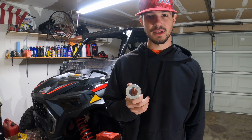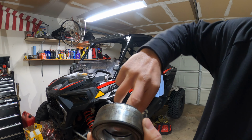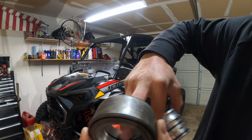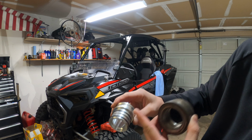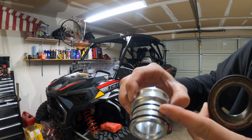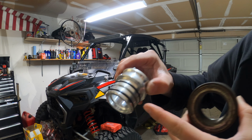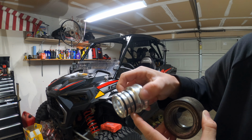And if you're wondering how this greaser works, I have an old bearing of mine. It just slides right in there. And there's an inner, not even a race, I don't know what you would call that, a groove. And how it works is you will pump grease into this grease zerk. And there's a little hole right there. I don't know how well you can see it. That's where the grease will come out, and it'll start squeezing out along the inside of this ring.